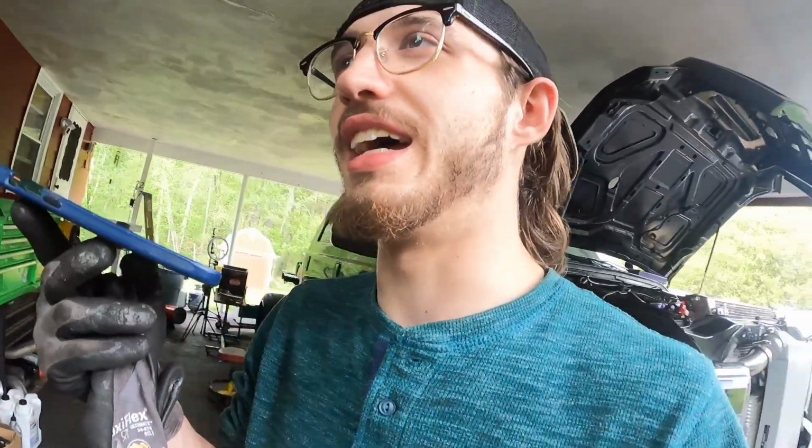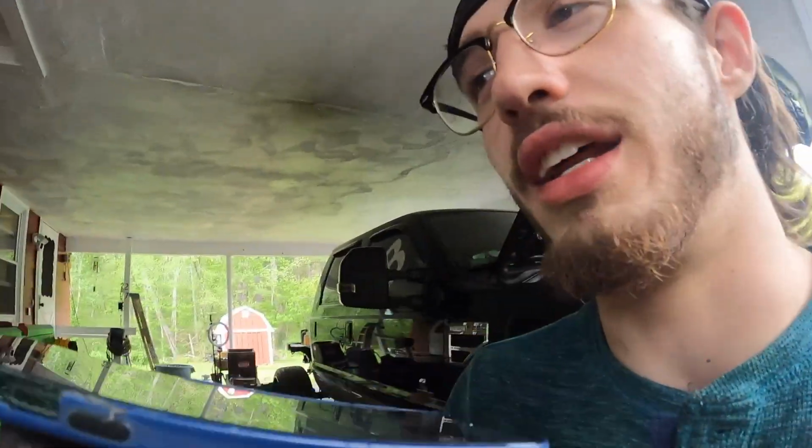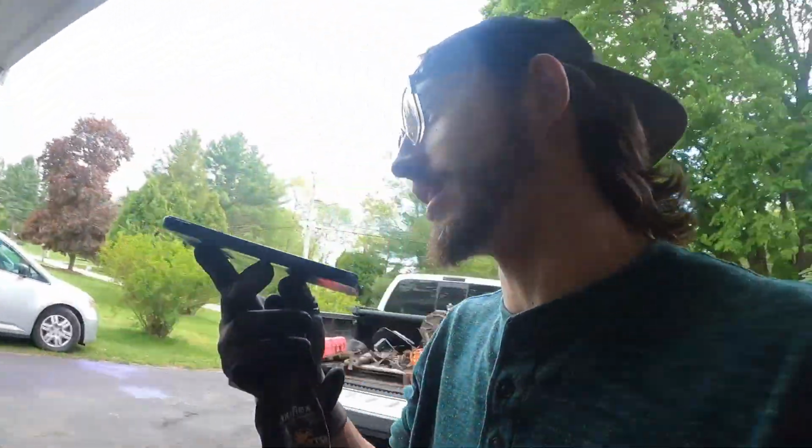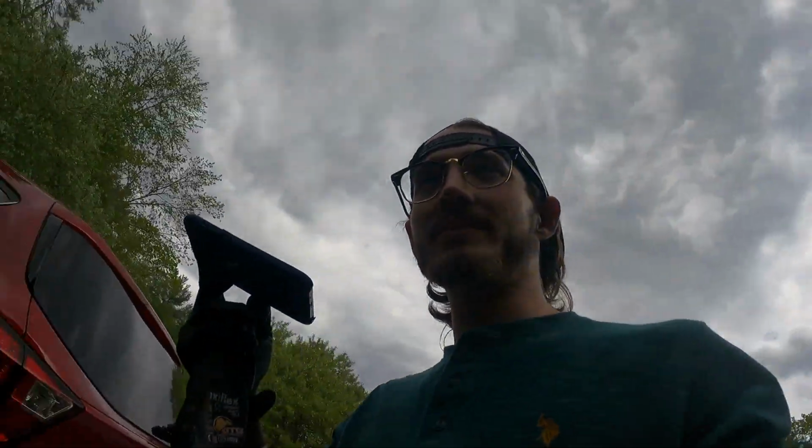That sounds like something that was probably already happening to it. Yeah. But yeah, I guess. Because, like I said, it's been happening for a little while. Sometimes when I'd be in drive on the brakes, the truck is trying to drive forward, you know what I mean? Yeah, that sounds like torque converter for sure. Yeah. So I'm like, what the fuck? Because it wasn't like that for the first 4,000 miles or so. Yeah, so if you got a new trans, you put it in, and yeah, before you get in there.